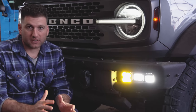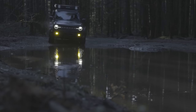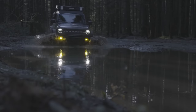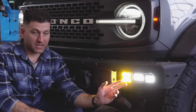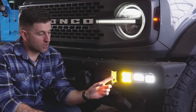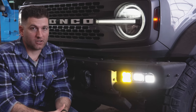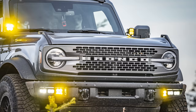Let's get into the walk around starting at the front bumper. One of the first things I did was address lighting — I found that the Bronco had really poor lighting when I first started using it. Because I have the modular bumper it didn't come with fog lights, so you have a couple options as far as a fog light pocket kit. I chose Diode Dynamics. The SS3s are 1,988 lumens at 6,000 Kelvin and Diode Dynamics has their own bracket that they send with this kit, so it's all plug and play into your upfitter switches. These were a game changer for me, specifically the amber fogs — I use them all the time.